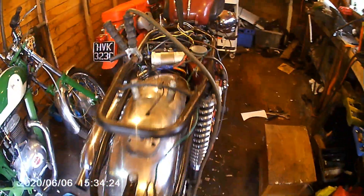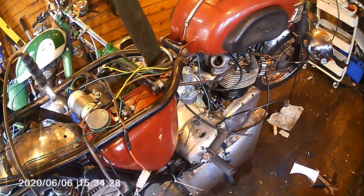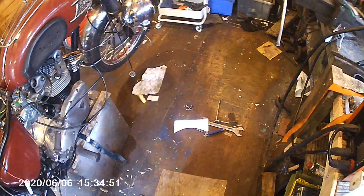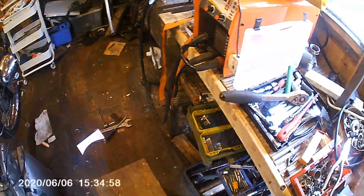Right, things we've found really: the ignition timing was out. But this carburettor that was on — when I checked the numbers, the numbers there, 37533 — it's off an Ariel Arrow. So it's a two-stroke twin 250. This is a 504 four-stroke. I don't know what needle's in it, or jets or anything else.